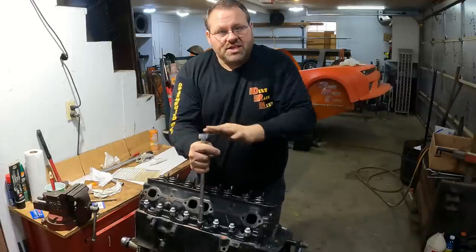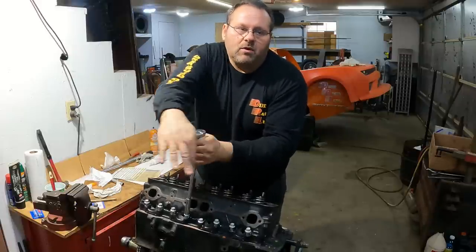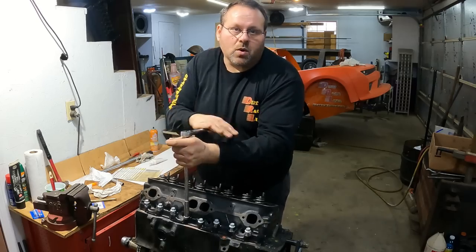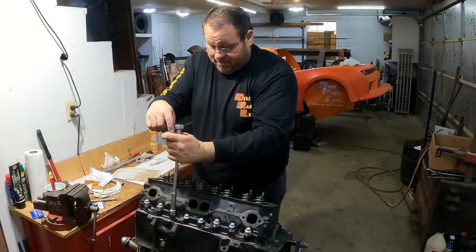Anytime you're on a metal shim head gasket, you always need to retorque. The only ones you wouldn't are the composites, like Felpro's composite Permatorque head gasket, but it's not a bad idea to do it regardless.